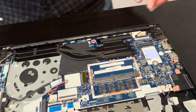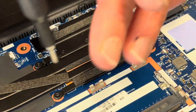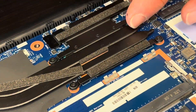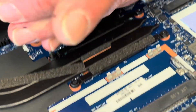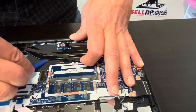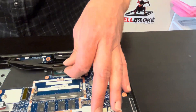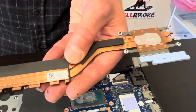Now here is the heat sink. If the heat sink is clogged, doesn't disperse heat properly, or is bent, it won't work and you can replace it. Unscrew these screws and gently take it out — don't bend it, it may be stuck because of the cooling paste, so be gentle. Here we have our part number.